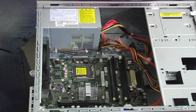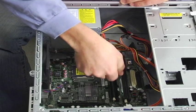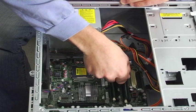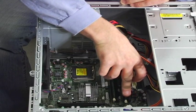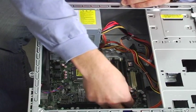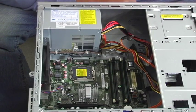Now let's try the second one. Make sure you put them both in the white or both in the black — make sure they run together and correspond. They cannot be the other way or they will not work. Push down with two fingers, hear your snaps. There you have it — your RAM is installed. Easy upgrade.